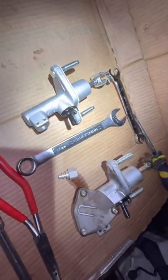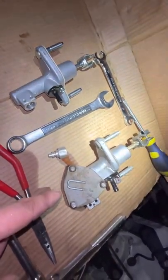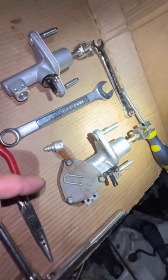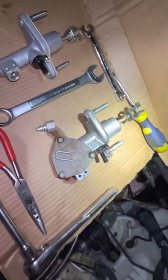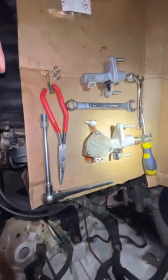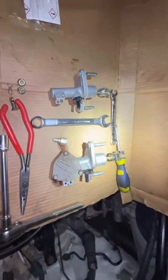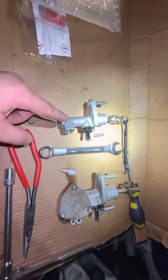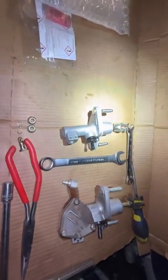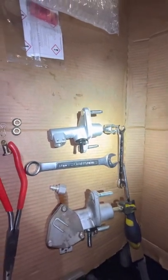The reason I'm replacing it is because the clutch is getting a spongy feeling. I have to take off my shoe and shift carefully — pretty dangerous. I have an AutoZone slave cylinder on there, but the main issue is it's still doing it. So I opted for the EM2 Civic clutch master cylinder.